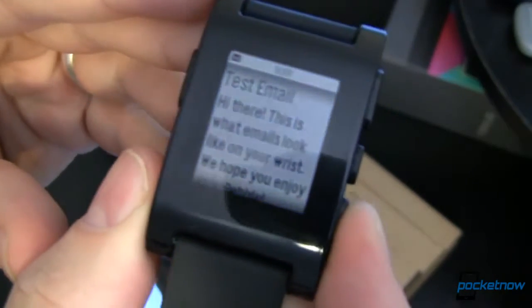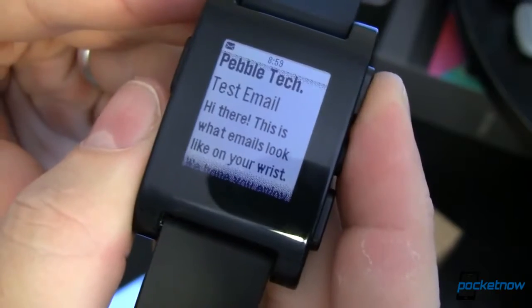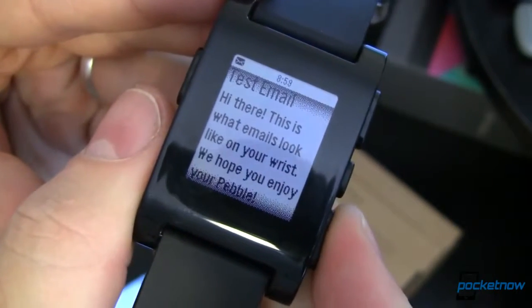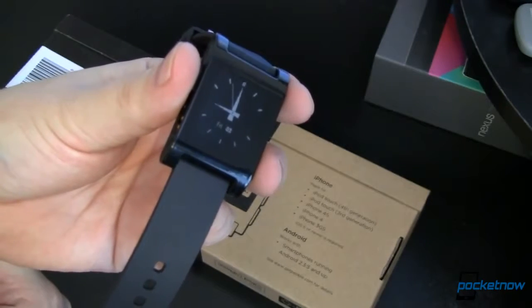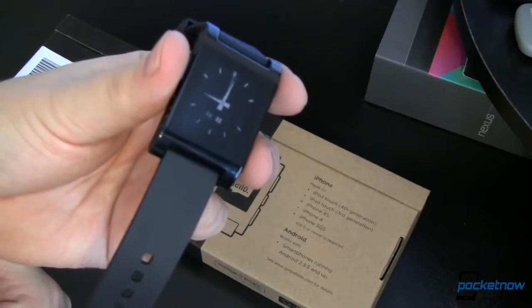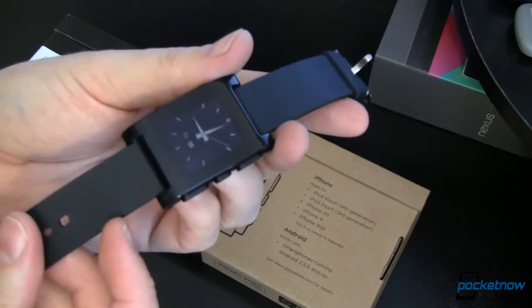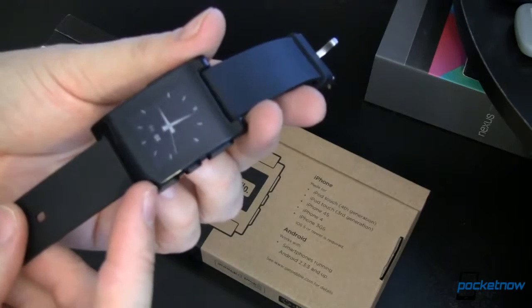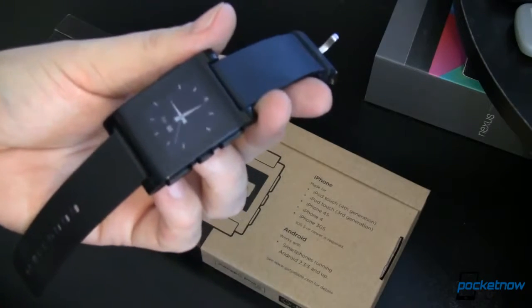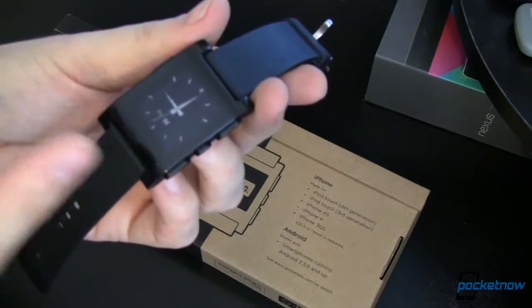If you can't see the pixels in the text, look at the shadow at the bottom and top of the display. As I scroll, you can see this faux shadow to let me know there's more to scroll to or that I'm done, and it's pixelated and just doesn't look as pretty as it should. Also, this display is not e-ink. I thought it would be a display like the Kindle or the Nook — perfectly readable, using microscopic drops of ink turned to display black or white — but it's not. This is a liquid crystal display, which means it's going to use more power than e-ink and probably won't be as legible in bright sunlight. They do still call it e-paper, but not e-ink, which is confusing. Don't be confused — this is LCD, not e-ink.